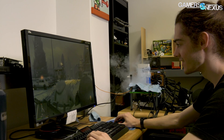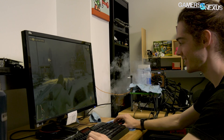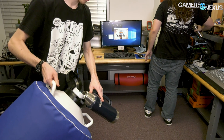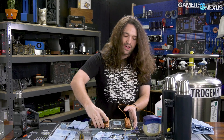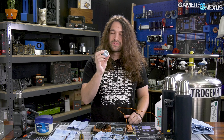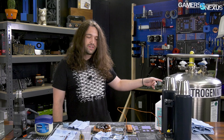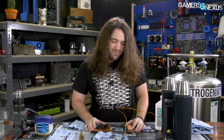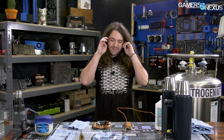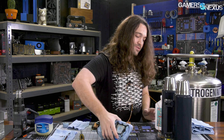The most common complaint we've gotten in the liquid nitrogen overclocking streams is that apparently people think it's not practical or something, so we're going to show you how easy it really is. All you need is a $300 to $400 liquid nitrogen pot, ideally a $1,900 video card pre-prepared for liquid nitrogen — although you could do some hard mods yourself — a giant tub of Vaseline, a brush, some good paste rated for minus 130 degrees Celsius or below, a heat gun, and some liquid nitrogen. Please actually look into what you're doing if you try to follow that advice, because it's obviously impractical — but we're going to set it up and do some gaming with LN2 anyway.